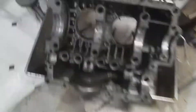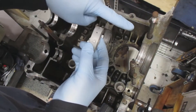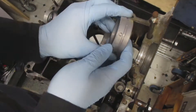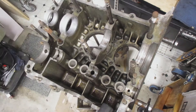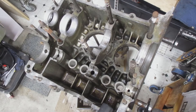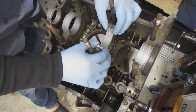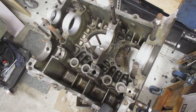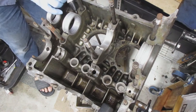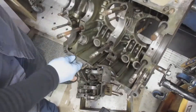The second one in from the thrust bearing has two halves for the bearing. Make sure the dowel hole faces the flywheel. I pre-install all the main bearings into the dowels, then I take a sharpie and mark the case and install the main bearing on the other side, then I remove the main bearings.